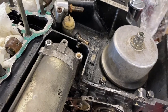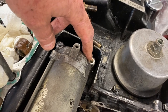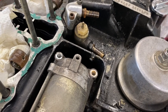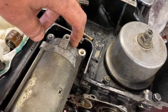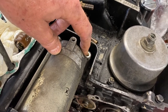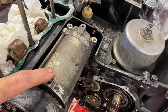What I'm going to end up having to do is make a sleeve — a steel sleeve on the lathe that fits down inside that hole. I'll make it a little bit snug so I can tap it in. Then I'll use a drill bit that's a little bit smaller than the sleeve but about the same size as the broken bolt, and use this as a guide to essentially plunge-mill that broken stud down and keep trying to move this thing. As soon as we can get the thing to pop out, even if there's a tiny bit sticking up, we should be able to weld a nut to it and get it out. Considering it's aluminum, it's a prime candidate for that. This is a new one on me — I haven't experienced this before, and it's going to be a tough one.